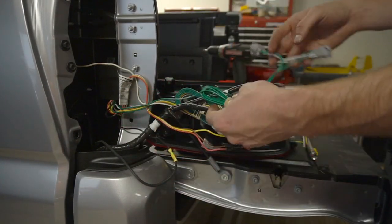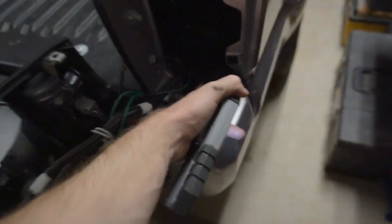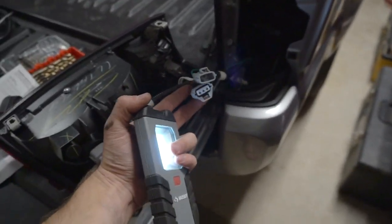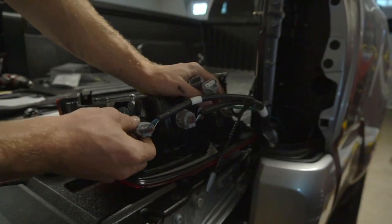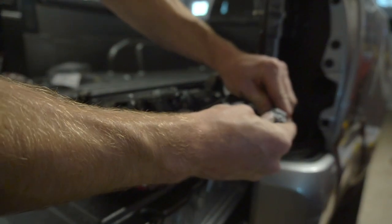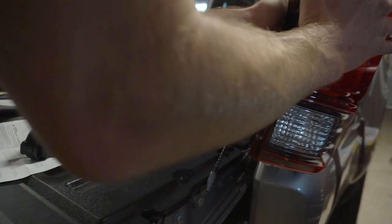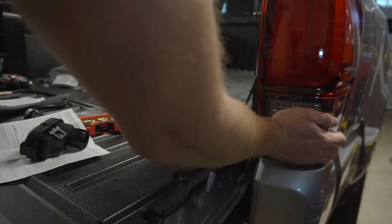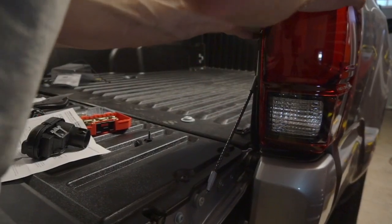The green side we need to fish onto the passenger lights. The wiring harness goes down, all the way over, and then up. Just follow that wiring harness with the green wire and you'll be all set. For the green wire, you can see it's the flat three — the flat three is the top one. Just pinch and pull, plug in here, and then plug in here again. Now we're done with this side. Go ahead and move the wires towards the back. Remember there are two clips — one on the bottom and one on the top.